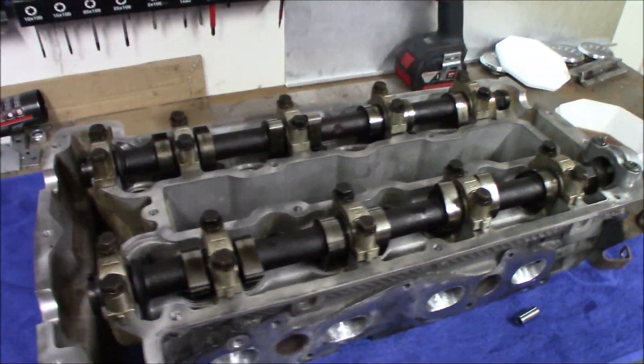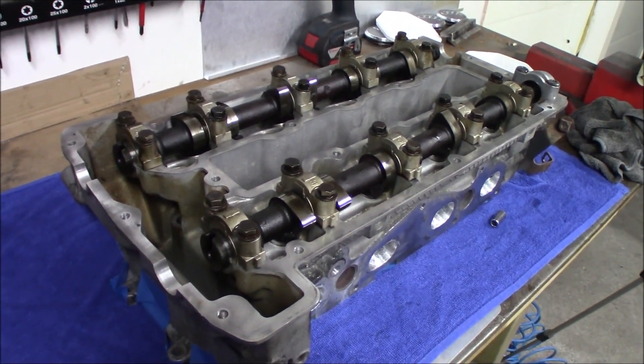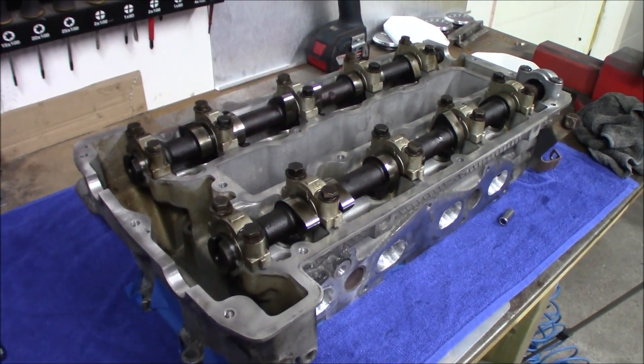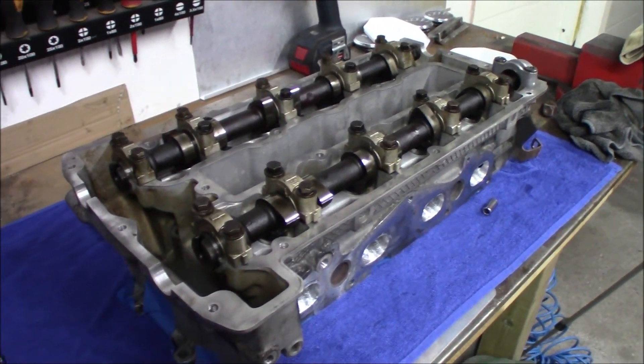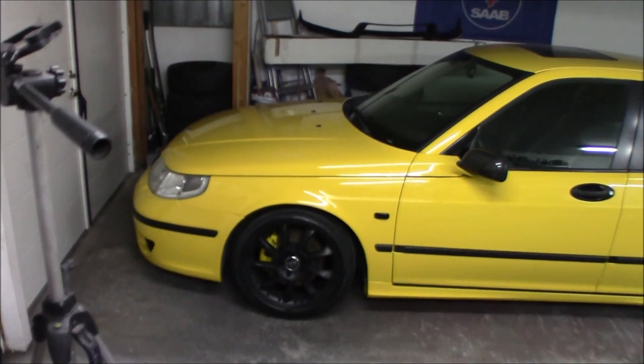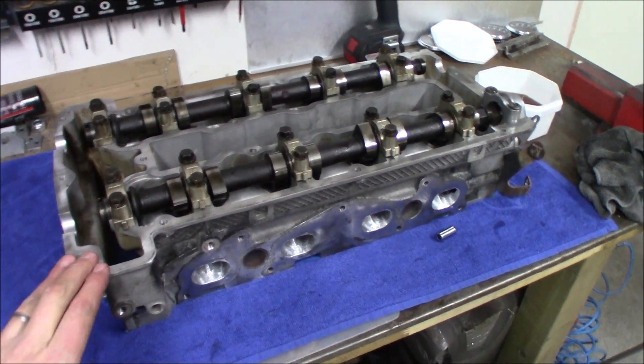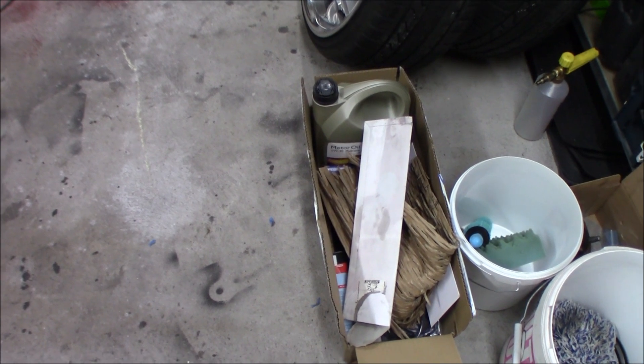The cams are in, and in the next video we will do some magic with the camshafts and the adjustment of the timing ring, since these have a little longer duration and don't fit 100% bolt-on — there are some adjustments needed to get the most out of them. The next episode will probably be stripping the engine down and making the full change, since the cylinder head is done, we've got the parts, and the pistons and rods are ready in the corner. Thank you guys so much for watching — subscribe, give it a thumbs up, comment any questions, and I'll see you in the next one!